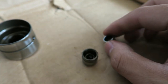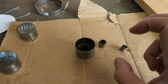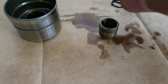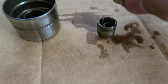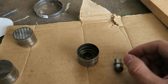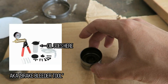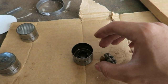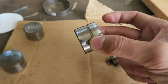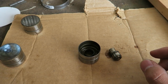So if either the spring is broken or either the check valve is broken, you've got to replace the lifter. The next step after you clean all these out is that you actually have to assemble it, which is as easy as putting this piston back in place like this, flipping it upside down, and snapping it back into the lifter. The second step after that is to actually obtain a vacuum pump that you will fill with oil and submerge this entire lifter into it. Then once you crank it by hand, you'll see air bubbles start coming out of it. Those air bubbles will basically escape the entirety, and essentially you'll bleed out this lifter so that you'll have a fully pumped lifter ready for reinstallation.